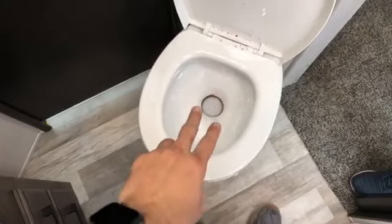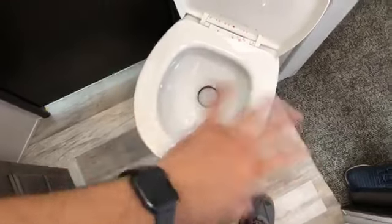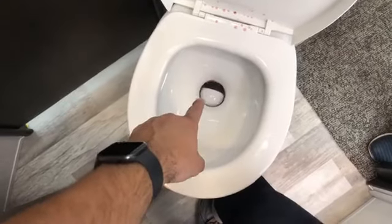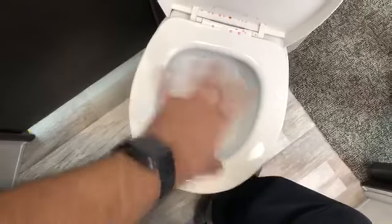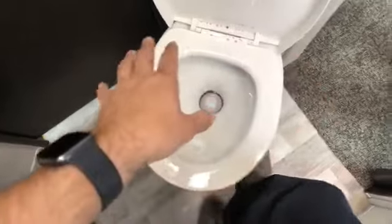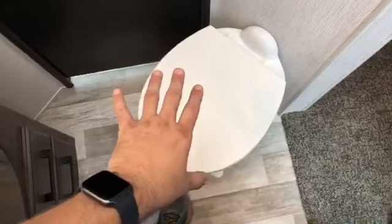Only number 1, number 2, single ply toilet paper or RV camping toilet paper goes down this hatch. Nothing else. It will jam it up. Sometimes what will happen is it'll get in here and leave this ball valve open, and if you've got pressurized water and it's locked right here, it may look closed, but it's not closed. It can backflow into the unit and you can have a flood. That has happened many a times. So you want to make sure that the toilet operation goes silent, and you want to watch it before you just walk away, unlike one at home.